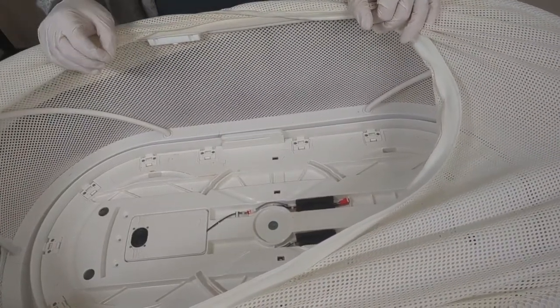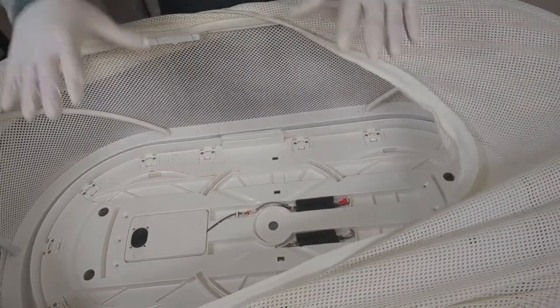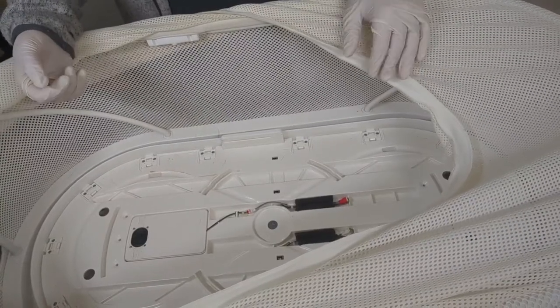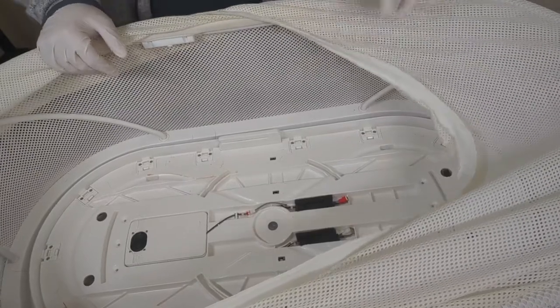However, since we're already here, I'd like to take this down just one more level and check the layer below this. I want to check all of the O-rings. They're the most common reasons that a SNOO will fail is the O-rings. And we'll go through and I'll walk you through that here as well. Pretty quick process.